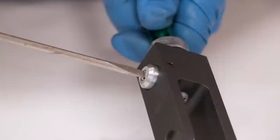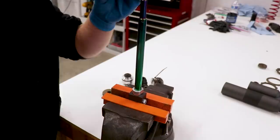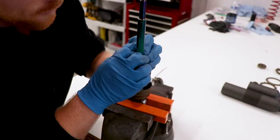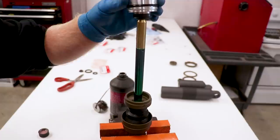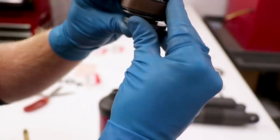These colors are really gonna stand out. Next up, we've got to get all of this onto the shaft in the correct order. First up is the cup for the bottoming cone, followed by the bottoming cone itself — this one's all black, usually they come in a really ugly yellow color. Then we've got the cap for the bottom of the shock body. Next in line is the seal head, but we'll need to put a seal bullet on top of the shaft to protect the seals — put some oil on it and on we go. Last up is the shim stack and piston assembly — cut the zip tie that holds it together, keep everything together, and onto the shaft we go.